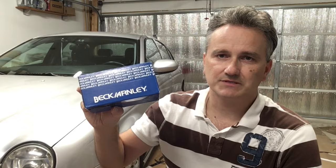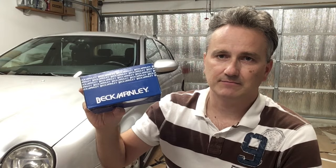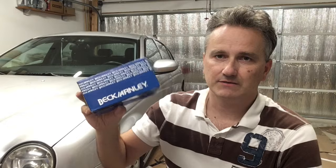Number 3, misfires. These are typically caused by a bad coil pack, sometimes a bad plug. Make sure you fix this as soon as possible, because if you don't, this leads to much bigger problems, which I'll talk about later. For the coil packs, I try to buy the best brand name available at the lowest price. I found this Beck Arnley is usually reasonably priced, much cheaper than OEM parts, but still good quality with a warranty.